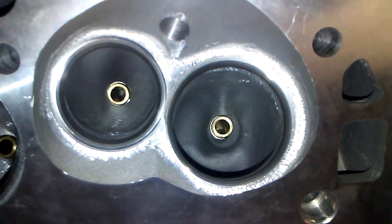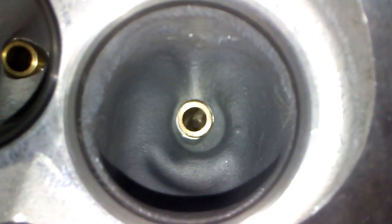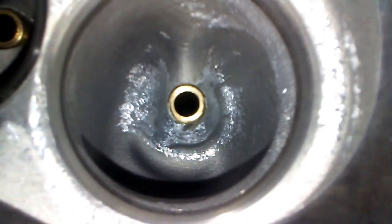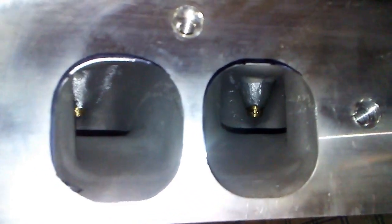Here's a big block head I've been doing some port work on. That's what the guide looked like before. And there's after. I had to streamline it, because that one's round and sticks way out in there for whatever reason. Took the lip off around the seats. Did some work around the plugs. Have yet to gasket match it.